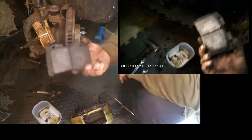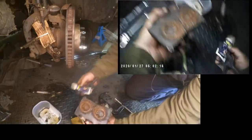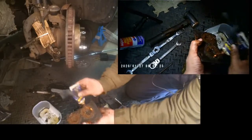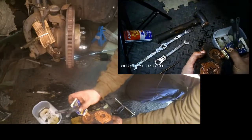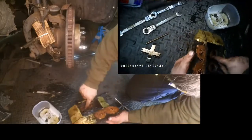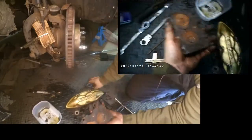There are your brake pads. Now the fitting process is pretty straightforward — get your new brake pads and slide them into place. But before you slide them in, get yourself some copper grease. This is what copper grease looks like — it's got the typical copper colour. Smear a bit on the back of the brake pad, so that it will be greased between the piston and the back of the brake pad.